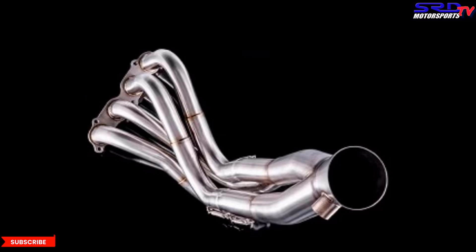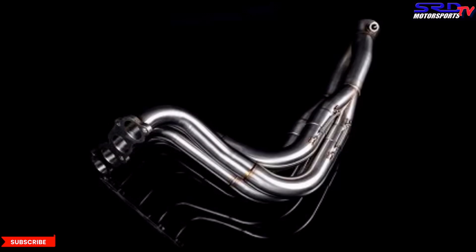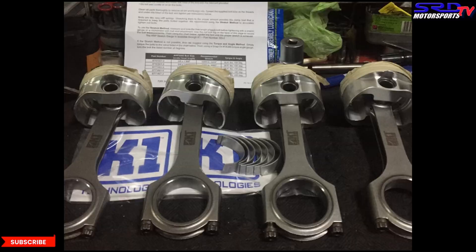Because it's running a healthy compression ratio, I managed to convince the owner to run a K-tuned big tube header — this way it's not constricted and won't ping or detonate on pump gas, because it's going to be on pump gas. This is a street car, not a race car — no E85, no methanol, pump gas on a muffler in an actual four-door. Since it's a street car, the owner expects it to run on an airbox and air filter. That's a challenge we always like because it's realistic.